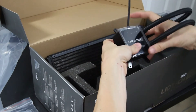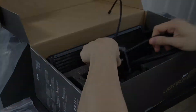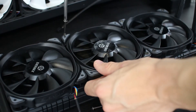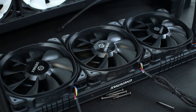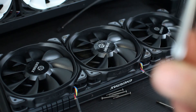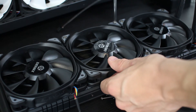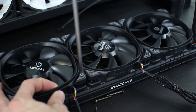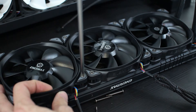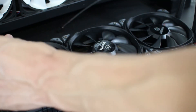I'm pretty stoked about installing this. The question is performance, so let's get into that. Installation should be pretty simple and straightforward — nothing extravagant compared to custom open loop. Let's mount the fans to the radiator in the orientation that best suits your needs using the supplied hardware. I have two recommendations: always use the hardware the company provides, as the screw lengths are a specific length for a reason — you don't want them puncturing the radiator. Also, always set up your fans in a push configuration if you can; temperatures will be better and fans work a lot better in push.